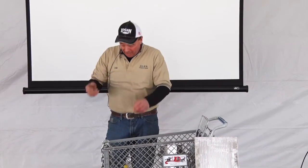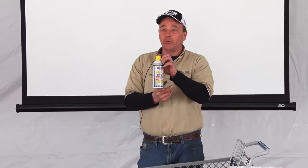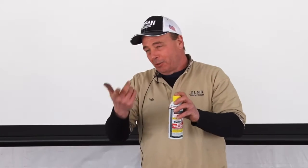Well, what happens is where it pivots, there's a little pin in there, and it gets rusty. And no one sprays it. Or if they do, it's too late because now it's frozen, and you could spray all you want. You're never going to free it up again. Get your husband, friend, or your auto repair shop, take a torch, heat it up, work it free, and spray it. I will tell you, this is your trailer's best friend: WD-40, PB Blaster, any spray-on lubricant. This is your best friend.